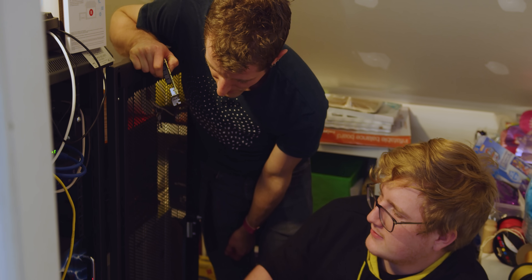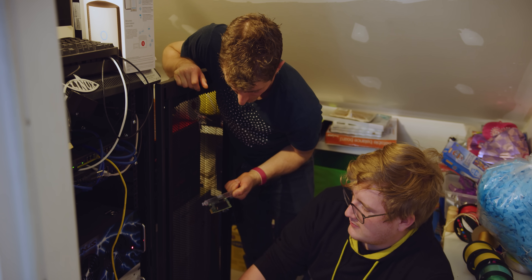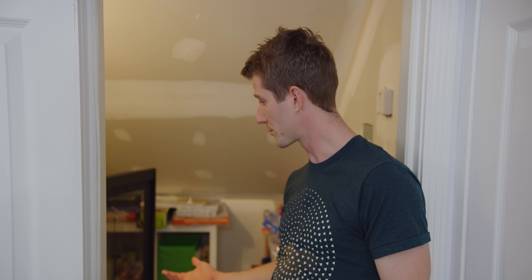One desktop already has 10 gig, the other doesn't, and the NAS doesn't either — so I brought two cards. One small challenge is I don't actually remember where we ran the cable for the media center or how it gets out of this room, so we'll probably have to retrace our steps, because that is not a 10 gig rated cable — it was Cat5e. We couldn't get Cat6a that was outdoor-rated easily or cheaply at the time, so this switch's release was really the magic bullet it took for me to finally go 10 gig.